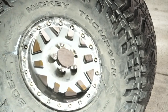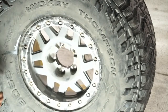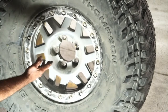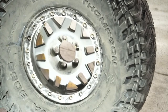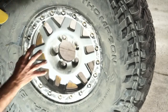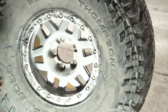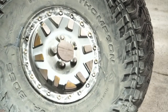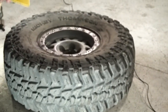The good news is that on a five-lug hub-centric setup, the lugs literally just hold the wheel on — all the load is put on the hub. So although it was moving, I really didn't stand a chance of losing it. Five-lug has been a standard lug pattern for desert racing for years. The lugs just hold it on; the center bore does the real work. We'll retorque all the beadlock bolts as well.